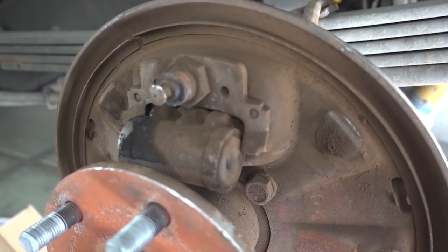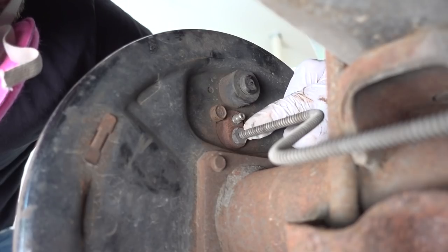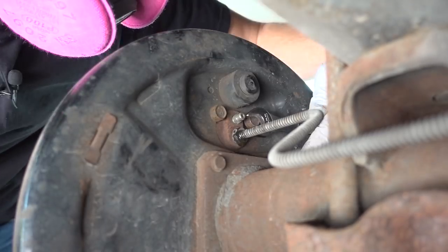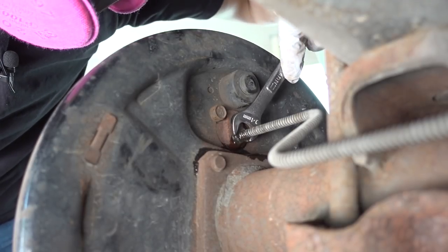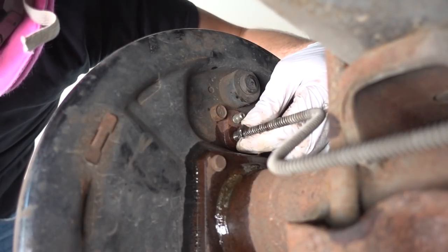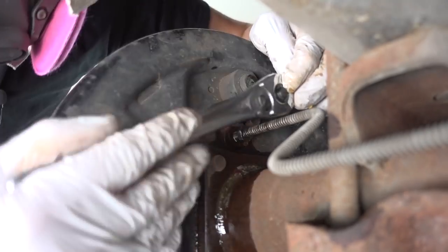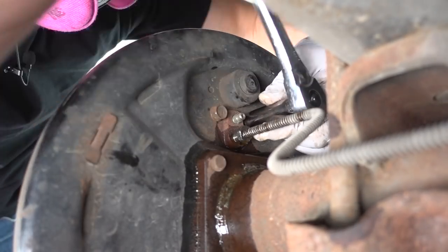We have everything apart. The next step is going to be to replace this wheel cylinder. I did pick up a new one — this is from Napa. The nut right back here on the brake line, that is 14 millimeter. I'm going to put my wrench on there and loosen her up. You might want to put a rag under there just to catch some of that fluid. This is loose. I just went ahead and used a pair of pliers to get that off the rest of the way. Next step is to get these bolts here — I've already pre-loosened them. They came off fairly easily. This truck doesn't have much corrosion because it's definitely a lightly used vehicle.